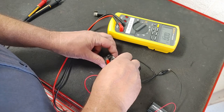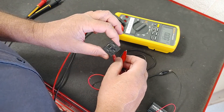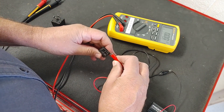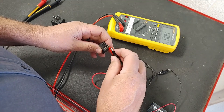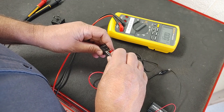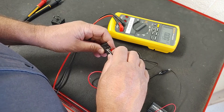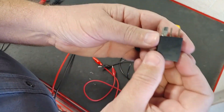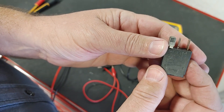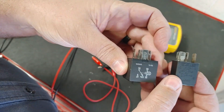So that's how you test a relay. This is what we call a mini relay; the micro is the smaller one like this. And it's 1, 2, 3, 4, 5 — tested the same way. So that's the outer printing, you can hear the clicking. We test across these terminals — 3, 4, and 5 — just like we do 87A, 87, and 30. It's the same exact thing, just a smaller package, and they numbered them 1 through 5, which actually makes more sense. That's just the way this one's different, but both tested the same way.